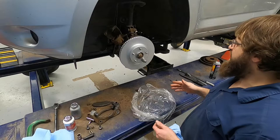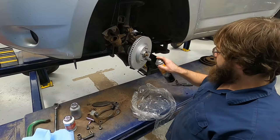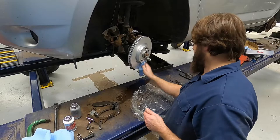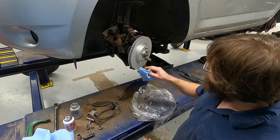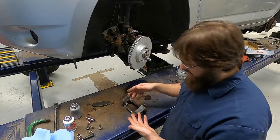That's going to keep our rotor tight for the rest of the work we're going to do. I'll turn this wheel so you can see what's going on. Now I'll take my brake cleaner — I haven't touched the back side, so I'll clean up the front. Get all that grease and oil; we don't want any grease, oil, anti-seize, or anything like that to get on the fresh stopping surface. Now we've got that nice and cleaned up. Set that off to the side. Carefully grab our caliper bracket, trying not to get into the anti-seize.